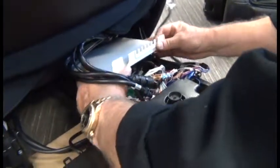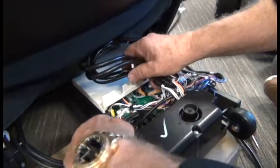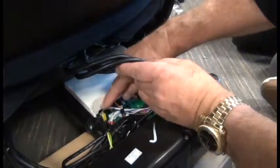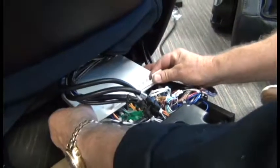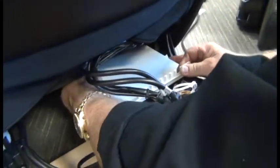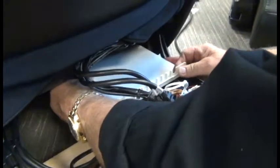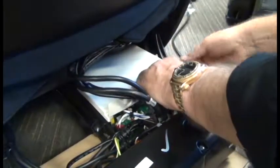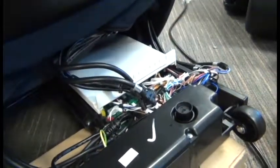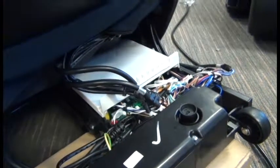So install the plastic cover back farther than it really needs to go, aligned from side to side, and then pull it forward until the screw hole in the cover aligns with the rearmost of the 2 screw holes in the tray. And hopefully the tabs will have caught the slots in the back, and the way you can determine that is by pulling forward on the plastic cover. You should be able to feel it catch in the back.